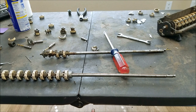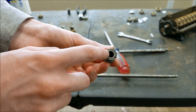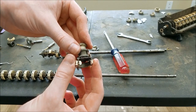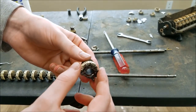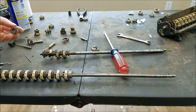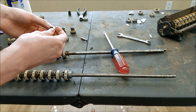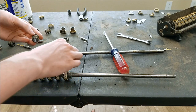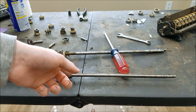I'm going to finish cleaning up — they're pretty much cleaned up now. Using the lacquer thinner cleaned out the inside so they'll slide on nice and easy. This surface is going to ride like that, so you want it pretty clean. On this side there's a step down — that actually goes inside the center of the wheel there, and that's what it rides on. That keeps everything spaced out so that the wheels don't bind up. The end of this piece will sit against the flat surface of the bottom one, and then the wheel sits on it — this provides the spacing so that you can't pinch the wheels against it. It's a pretty simple system.